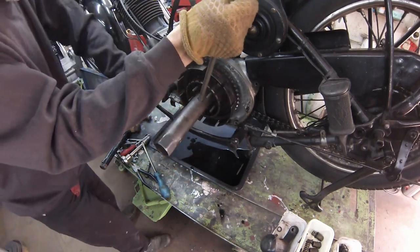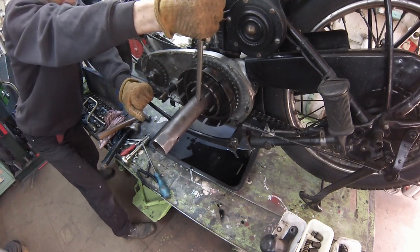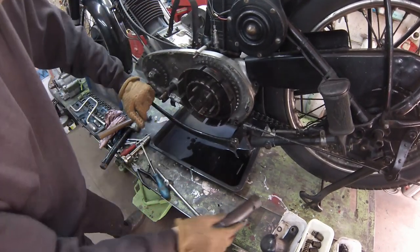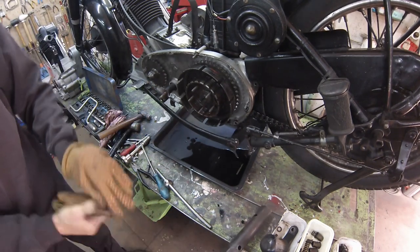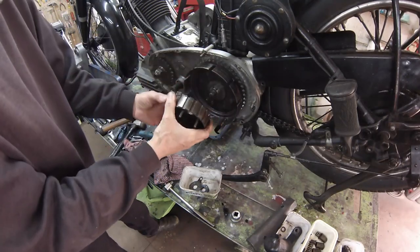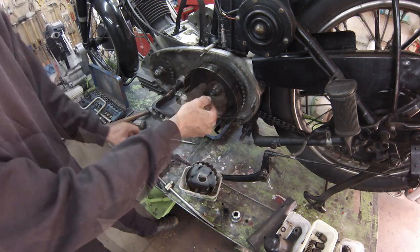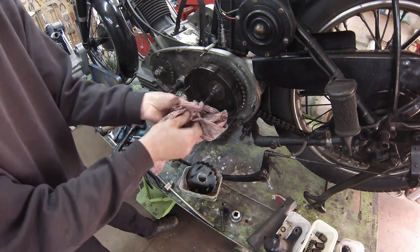Select second gear and refit the foot brake lever to give yourself something to lock the drive. Three hands and a big box spanner are all you need. It's tight to prevent chatter and the worn splines which result. Not everyone approves, but I wear gloves to save knuckles and keep myself within budget for sticking plasters when putting force into a spanner or socket. Pull the clutch centre from its splines and withdraw the push rod.